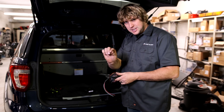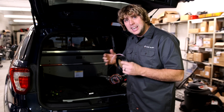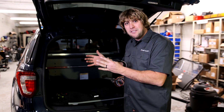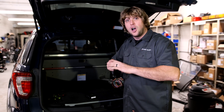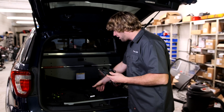In the law enforcement world, sometimes there's a sliding switch, sometimes there's a push button, but you want to tie the white wire into any mode when your emergency warning lights are broadcasting. So anytime the lights are blinking, if you've got the ability to have it come on for the rear of the car and the front of the car or different modes, you want to make sure you find a wire that comes on in all of the modes so that anytime you're showing traffic that you're there, you're also broadcasting safety cloud alerts.